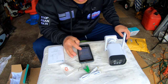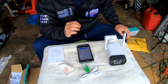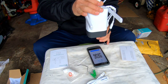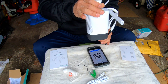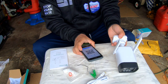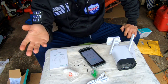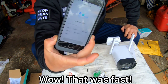Wait for the device indicator to flash or beep, then the voice prompts you to configure the camera. Click next, allow location access while using the app, then enter your Wi-Fi password. It generates a QR code — please wait for Wi-Fi connecting. Since I'm in my garage and my router is all the way on the other side of the house, I'm surprised — it says 'Addition Success' and 'Internet Connected. Welcome to use cloud camera!'